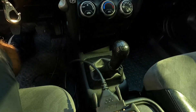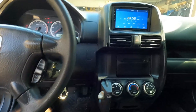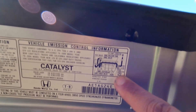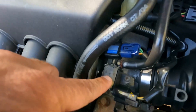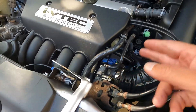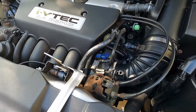If that's the only code we have, that's usually going to be your purge valve or purge solenoid valve, and that's up underneath the hood. We even have a little diagram under the hood showing that the EVAP canister purge valve is right here on top of this intake. This should be normally closed — it only opens when the computer tells it to, allowing the EVAP canister to vent into the engine and reburn those EVAP fumes.